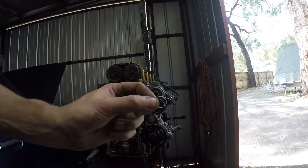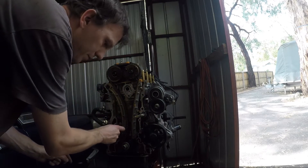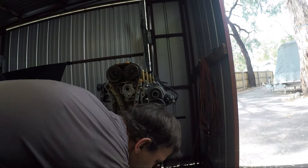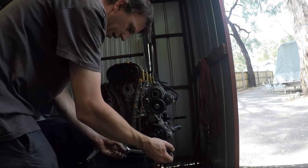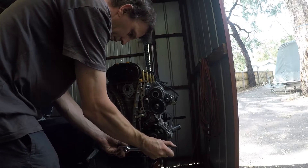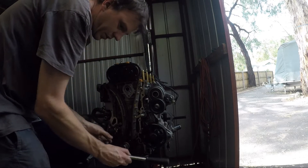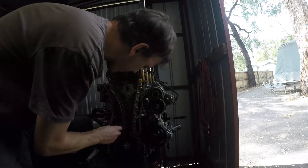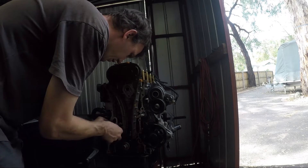What I've made is a little piece of wire like this to go in the timing chain tensioner. What you do is you just turn it back a bit to the liner, and then it should hold it. You can see I've got the tension there. Be a bit careful now with this in there, but now that the wire's in there, it should be okay.